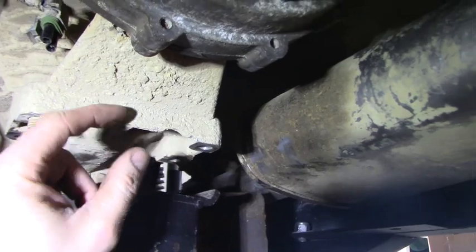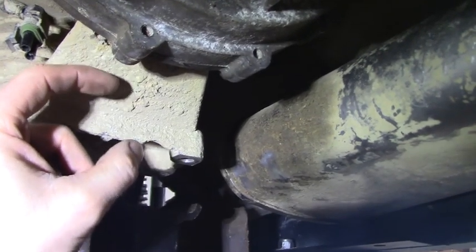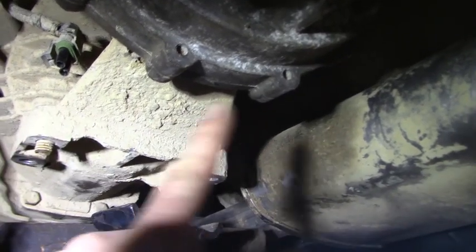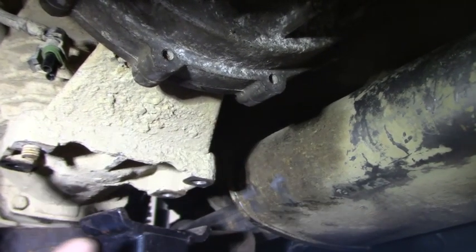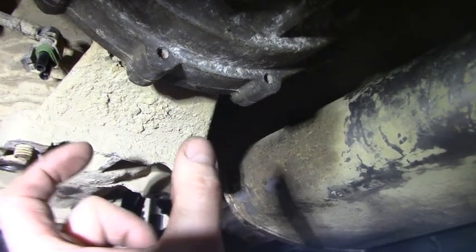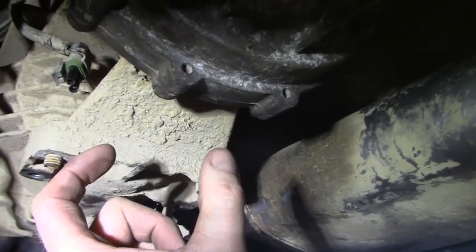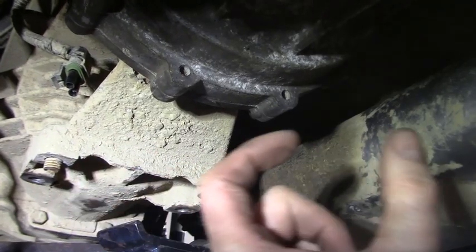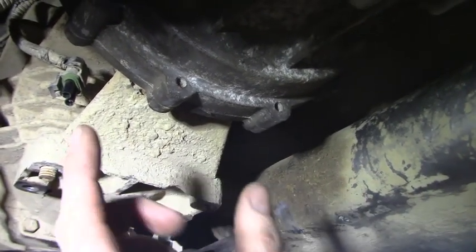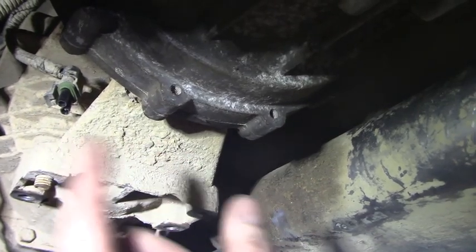So it's about a 1 inch clearance compared to down here. So I'm going to go ahead, I measured between that length, and then I'm going to go ahead and cut it down. Now I don't want to cut exact, and I'll show you that here in a minute on your tubing. I just want to cut a little bit to where I have room to slide those in and out. So let's go ahead and cut the tubing down, and then we'll get everything tacked into place.